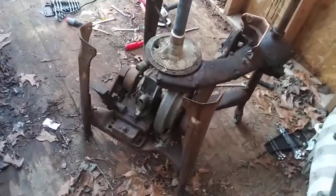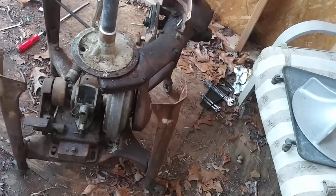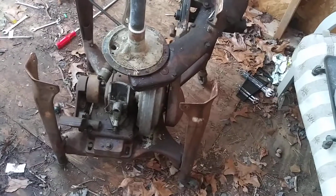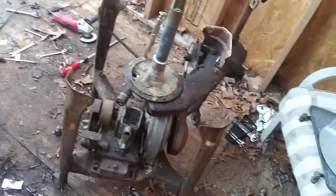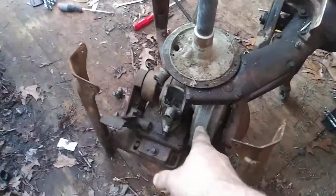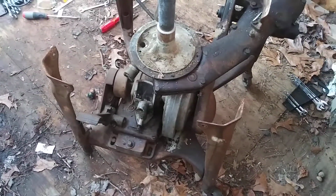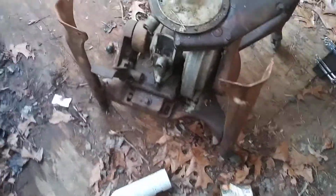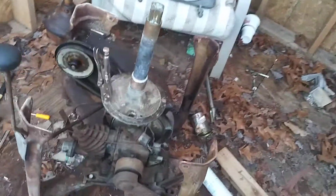And you can run these washers indoor. You don't have to run them with the hit and miss motor. They make conversion motors for these to run a regular 3/4 horsepower. A lot of them I found, did some research on, say a 3/4 horsepower, just a regular single phase 120 motor will work just fine. And you just pull this motor off and sit it on the shelf, keep it. I would highly recommend keeping it, and then quote unquote retire it and just bolt your electric motor to it, because it's really not that hard to do. That's what a lot of people did back then.